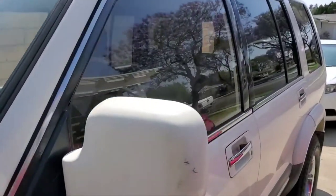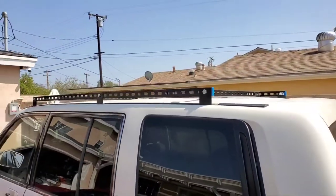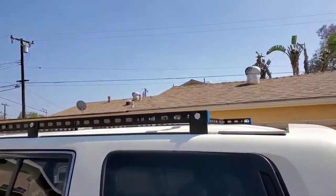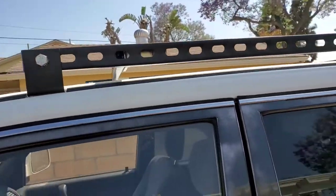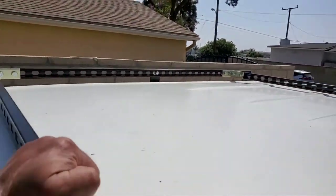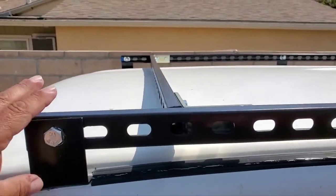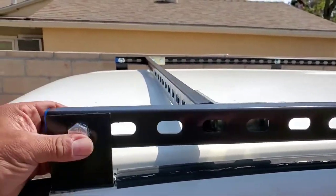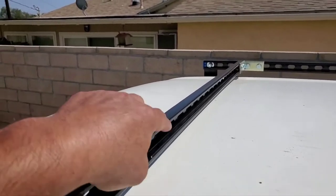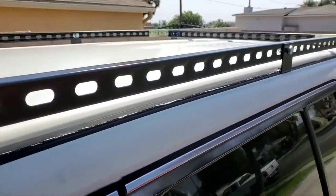The rack is pretty much done. Really like the way it came out. I painted it — I know the paint doesn't really stick to galvanized metal, but it looks fine. It's very, very sturdy. I can grab it and it'll shake the whole thing — this thing's not going anywhere. All this stuff you can get at your local hardware store: the Simpson Strong Ties, these are used for holding houses together so I know they're strong. The unistrut, bolts, all the hardware, the nuts that go inside these rails — everything. I'm going to probably fill in a little bit with some silicone.